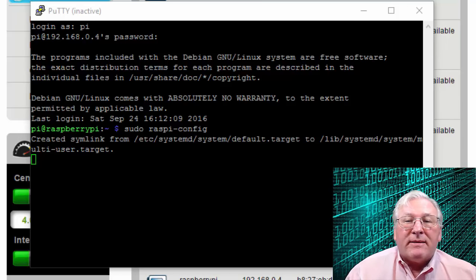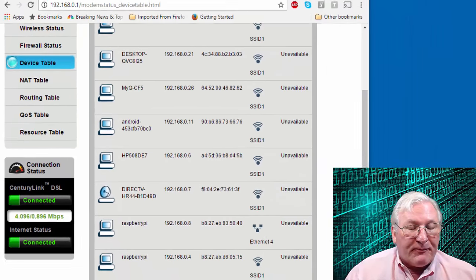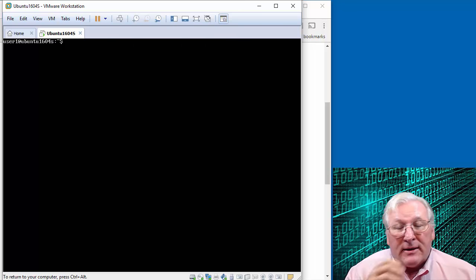The Raspberry Pi has had time to reboot. I'm going to close this and show you what connecting looks like on a Mac. I don't have the Mac hooked up, but the Macintosh and Linux systems are virtually identical because macOS actually is a form of Unix underneath the hood. So I'm going to show you a Linux terminal — it works exactly the same. Open the Macintosh Finder window, look under Utilities, and you'll see there's a terminal window there.